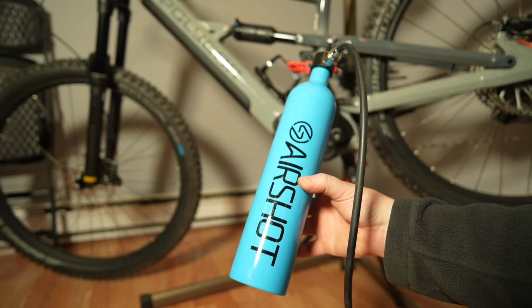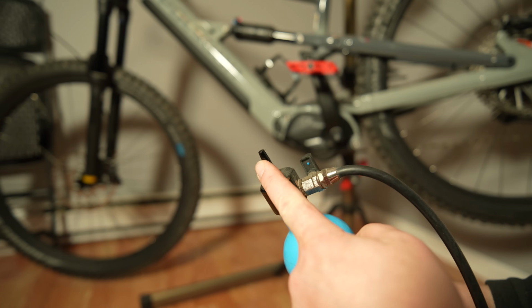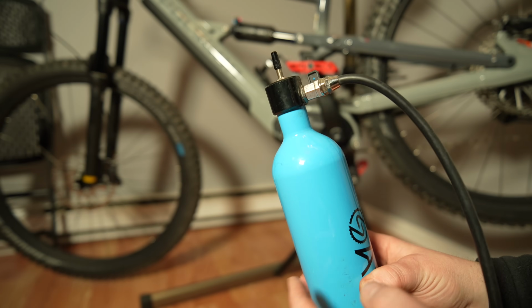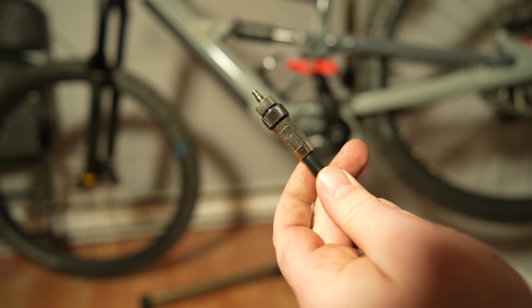But like I said, if you're going with brand new tires altogether, it is a little bit harder because you have to take the tire completely off the rim and put it completely on the rim, so you have to bead both sides, and it is hard to get it to bead. This is where air compressors come into play, or they make special pumps that have tanks in them that act like a compressor, and they sell little tanks as well. I just use my floor pump and fill up this tank, and then I can use that almost like a compressor to help blow the tire onto the bead.